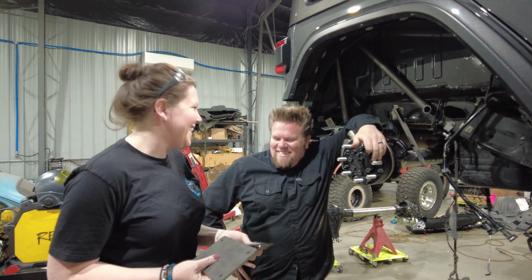And now this shock mount is tied to that shock mount. This front arm comes down. This front tube goes down this one. Ollie drilled this hole and went through onto both sides. This tube will actually stick out to the inside, and then we'll run another tube, not a full cross member all the way across. We'll just run a tube from here back to this cross member, which just adds a little extra strength.